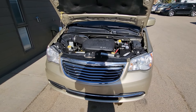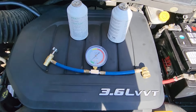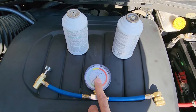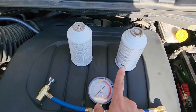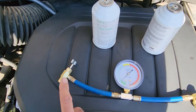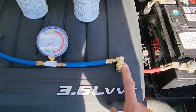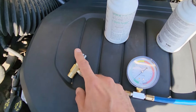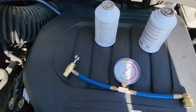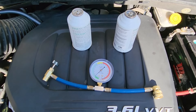But if you are on a budget, this is definitely something you can try doing. This is the recharge kit — it consists of AC recharge hoses with a gauge and it usually comes with two cans of AC refrigerant. How it works: you screw the can onto one side of the hose, connect the other side to the low pressure charging port, pierce the can by turning the knob all the way in, then start the vehicle and charge the system. Once you get the hang of it, it literally takes a couple of minutes.